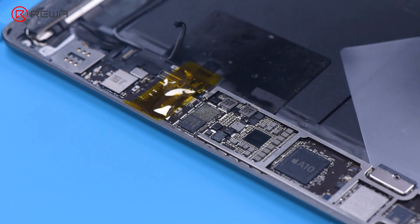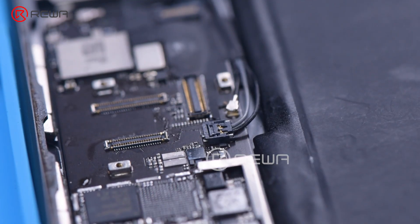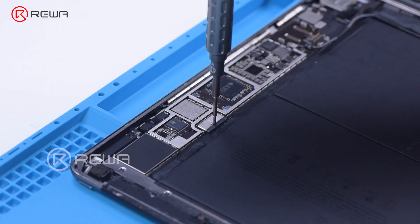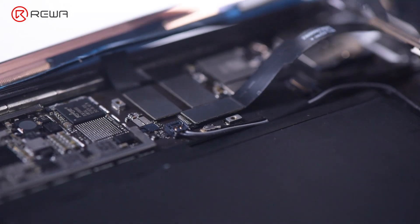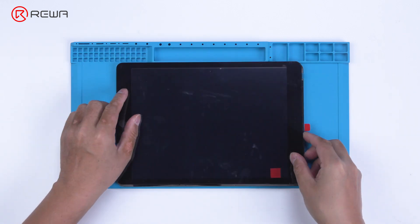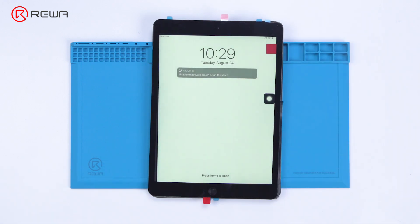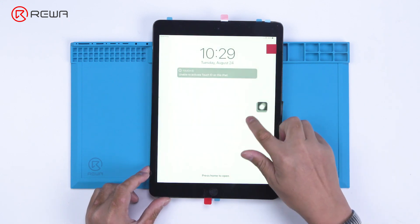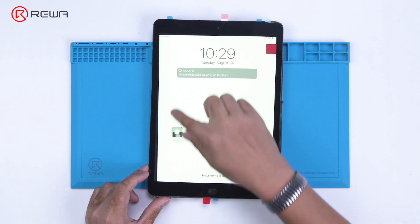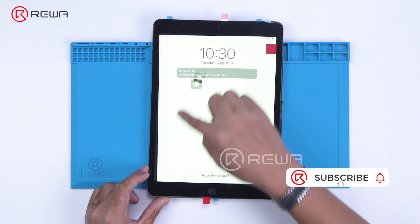After the motherboard has cooled, remove the high temperature tape. Connect the flex cable and install the screw. Then install the touch screen and display. Turn on the iPad. The touch screen has returned to normal — the touch jumping problem has disappeared. Please feel free to leave a comment on repair topics that you are interested in.